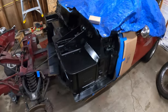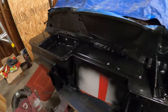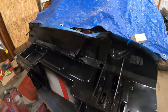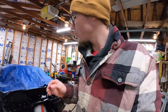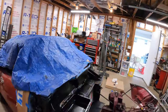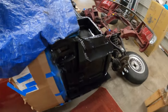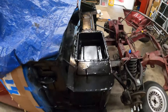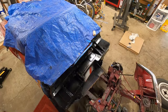So I let that paint dry for about 40 minutes. The can says to let it dry for 30 minutes, but I figure since it's not only colder than the recommended temperatures, but the humidity is also higher since it's raining. But it's looking pretty good. I don't know, it kind of looks a little splotchy, but I can't exactly tell. It's kind of weird to look at. But I'm going to spray some clear coat anyways.